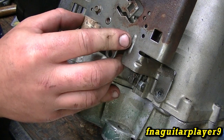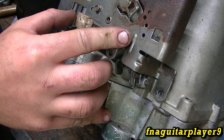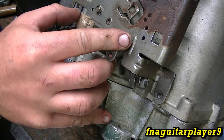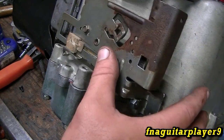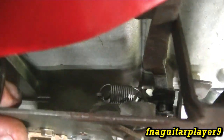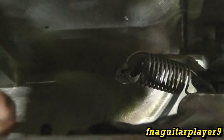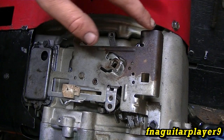Get the bolts lined up and when you pull it back you should have spring tension on it. Right now there's very little tension on that governor arm, but when you throttle up you get a lot more. Now go ahead and put the screws in. In previous videos I tried to show it from looking down inside there and you can't really see it — it's super hard to see — but you can make out the tab on the governor right there.